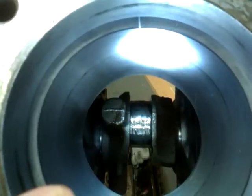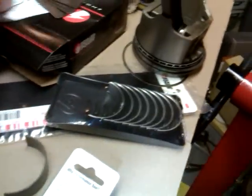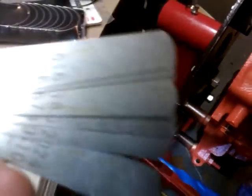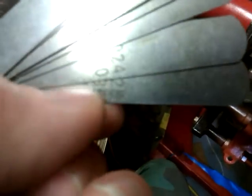A worn ring is going to be spread a little more apart. The way you check these is with a feeler gauge. A feeler gauge is a tool that has all these blades — it also has gaps for spark plugs on it, and brass ones, though I don't use the brass. The blades read 0.016 on one side, 0.026 on another, then going down: 0.025, 0.024, 0.023, 0.022, 0.021, 0.019, 0.018, 0.016, all the way down.